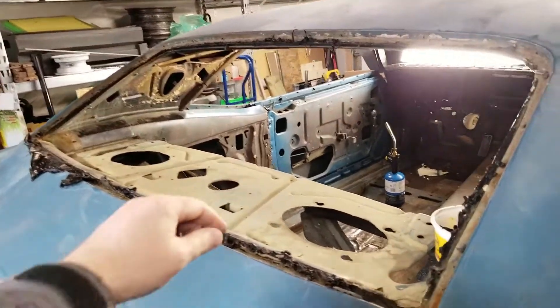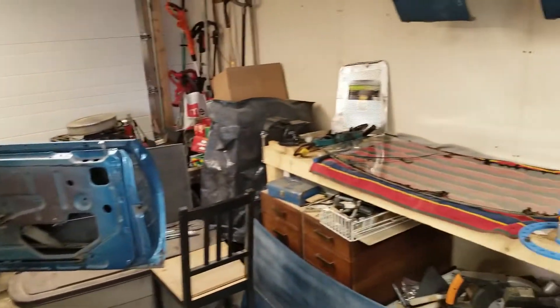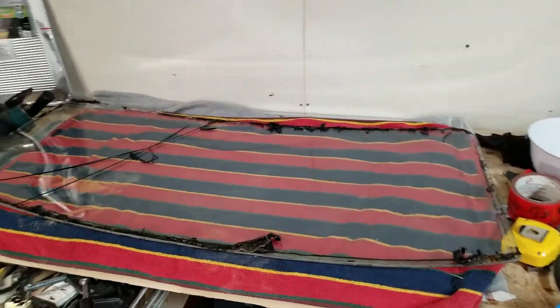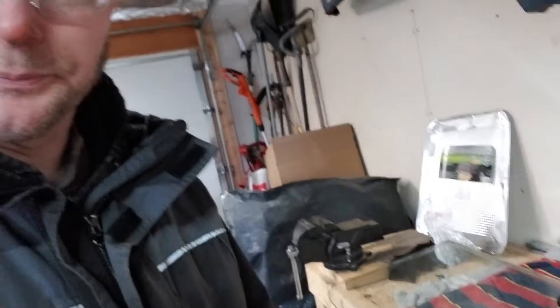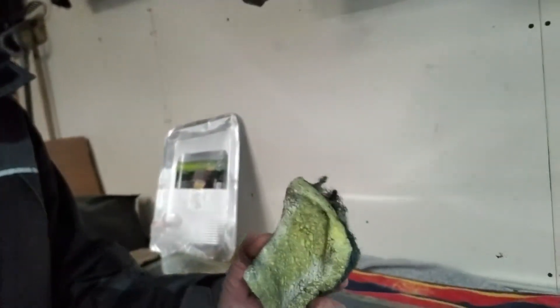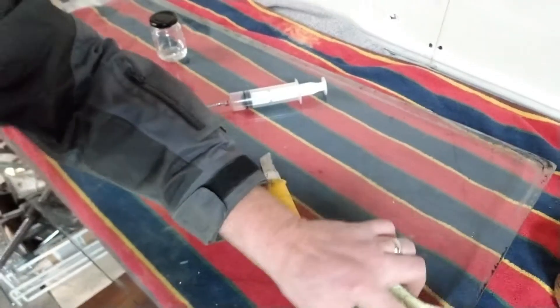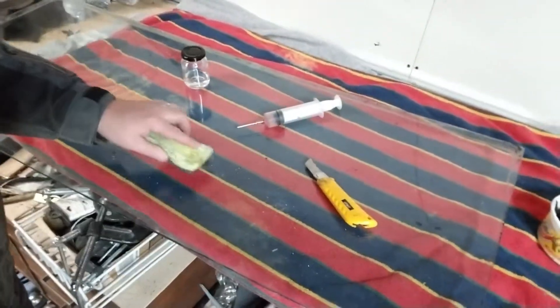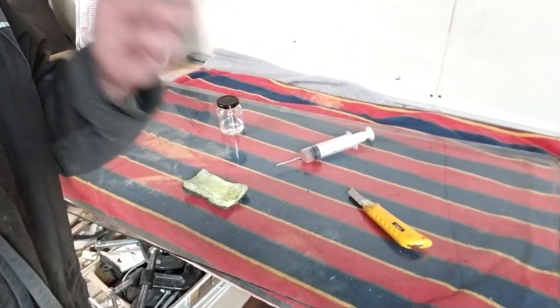The back window is out — that is some gooey, gooey stuff. Don't put it on anything you don't want it on. I got the glass out all in one piece; it's not scratched up or chipped, so that's a win. Now I'm cleaning the urethane sealant off the glass with a little bit of acetone, which I put in a turkey basting syringe and spread around, then use a little sponge with brillo pad material to work it off. The acetone actually eats this stuff so it works quite well. I was originally looking for rubbing alcohol but rubbing alcohol doesn't eat the urethane the way acetone does.